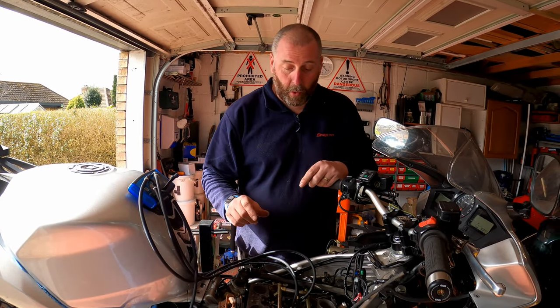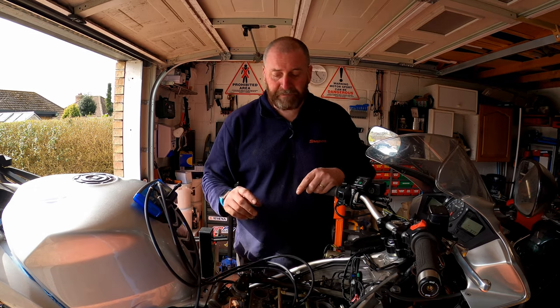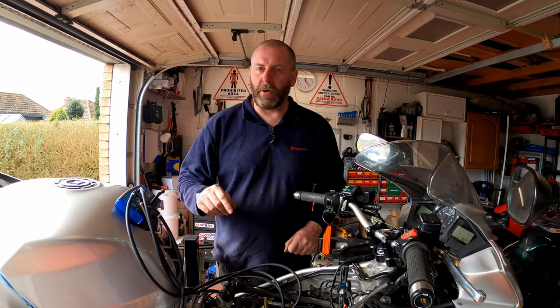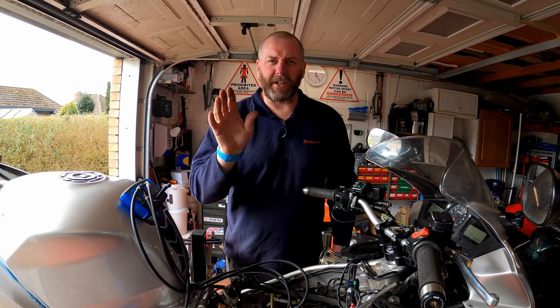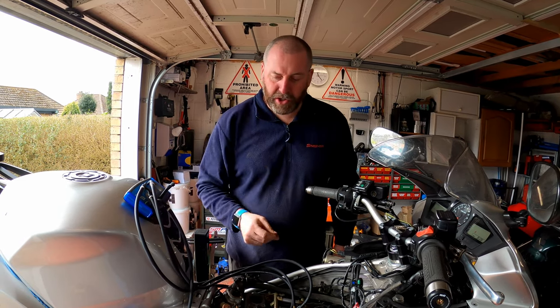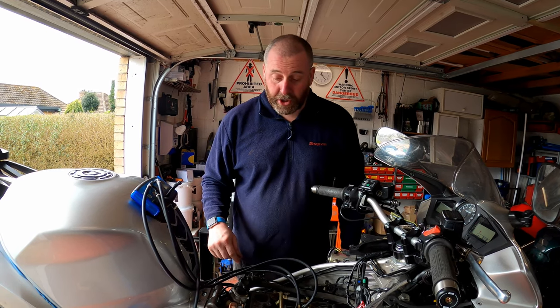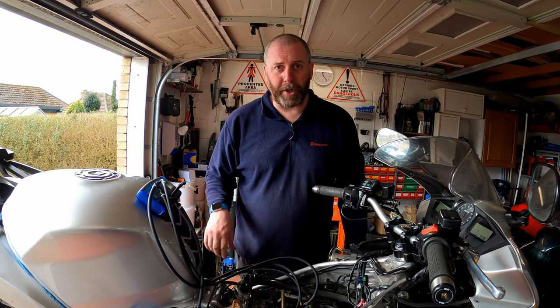I can turn this off and that is the job done. All I've got to do is put everything back on and we can call that job complete. There is a little bit of tweaking involved — once you've made an adjustment, just give the throttle a little blip to let it settle down again and you'll get a good accurate reading. Cylinder four was jumping across a range of around 15 points, and I've tried to balance all the other three into the centre of that range. All I need to do now is put it back together, start her up, and make sure we've got no vacuum leaks.